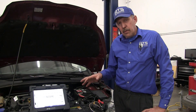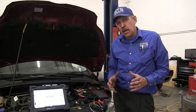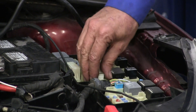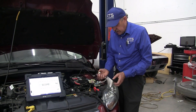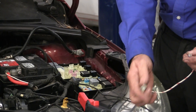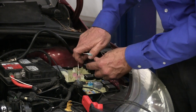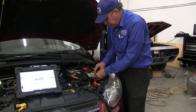We've got our oscilloscope and we're going to connect the ATS Elite 4 up to this Ford Focus. The first thing I want to do is get into the fuse box. I've already looked at a wiring diagram and this fuse right here is the one we're interested in — a 25 amp fuse that powers the transmission. I've made jumper lines with blades on one end; we're going to slip the blades into this unit so we can read the current through this fuse. If I can read the current, I can see what power is being pulled by the transmission.